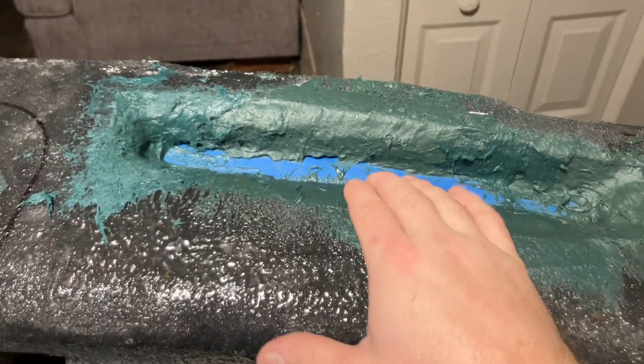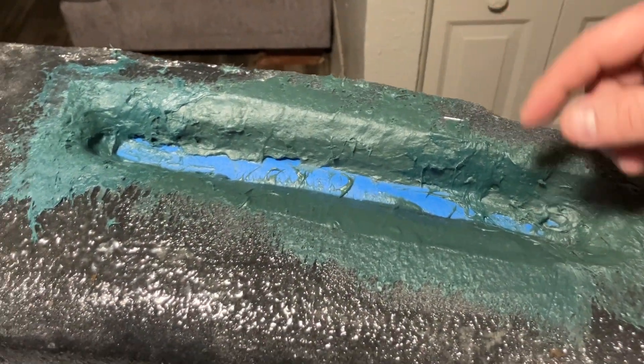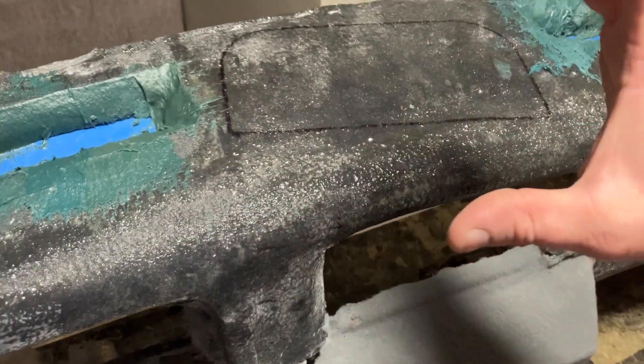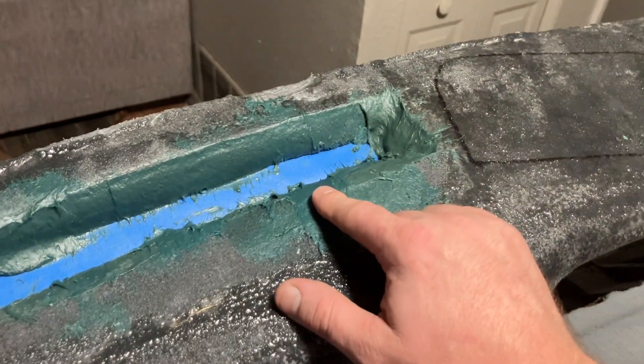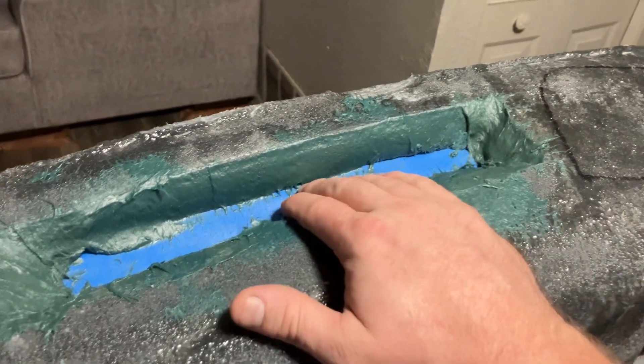Applying short hair Bondo on the vent area — it's still pretty hot. I like to use a lot of hardener. Like with the resin I use, I use a whole bottle of accelerant activator. On this stuff too, I like to use a lot of activator so it gets pretty hot.